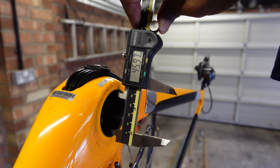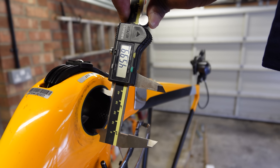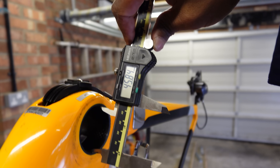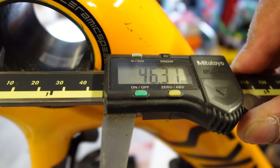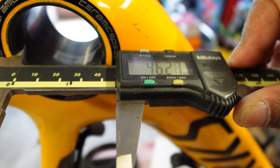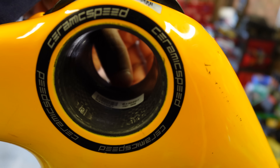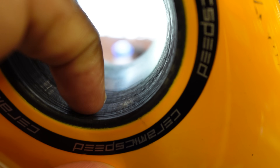In this case he rode it for ages and it chewed itself a nice little gouge into the bottom bracket. The drive side — the good side — is somewhere around 46mm, so there's nothing really wrong with that end; it's a bit oval but that's about it. The non-drive side is the side that got chewed up, spun round, spat round — measuring 46.3mm. That isn't even the smallest reading. So you're taking like 0.3 of a millimetre out.